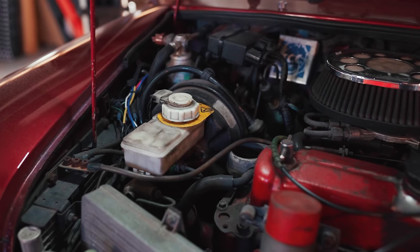Because of this, there are just more wear points. So you really want to be careful with these ones, that all of the wear points are in good order. A boosted system can feel great. It feels a lot more akin to a modern car, where you don't have to push quite as hard on the pedal. It really depends on what you're looking to get out of a Mini. Our preferred setup is to use a non-boosted system. The Minis are really lightweight cars and you don't need a booster. But if a booster system is on your car, it's obviously easier to leave it that way, and you can get a great brake pedal feel out of a boosted system.